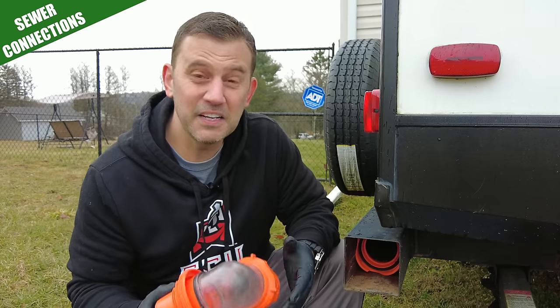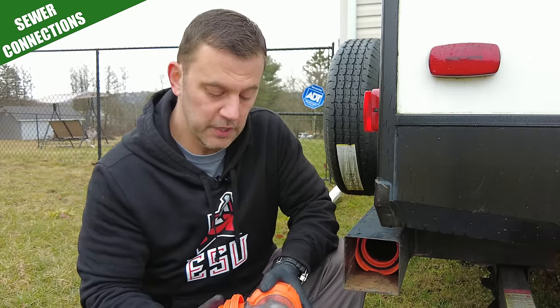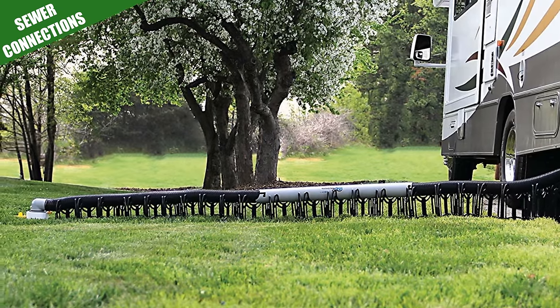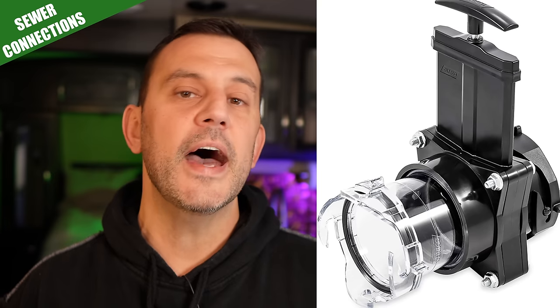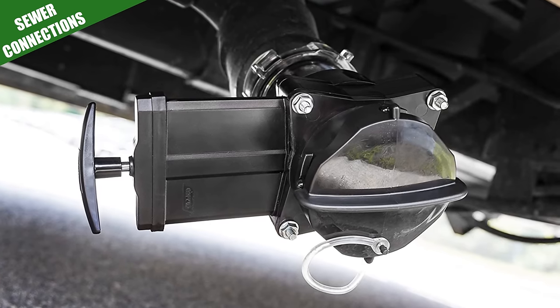The clear elbow is a must-have. Even though they come apart, they still won't fit in your standard RV bumper where you store your sewer hose, so if that's the case, pick up a bin with a lockable lid and keep sewer items separated from everything else. There are also sewer hose supports that keep your hose going downhill so everything flows directly into the sewer. Over time, your tank seals may start to leak a little once you take the cap off your sewer connection — if so, an external gate valve lets you connect your hose before you open the flow.